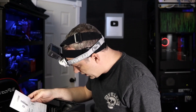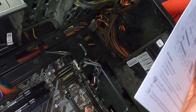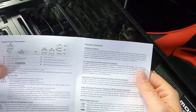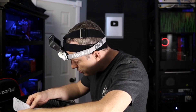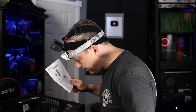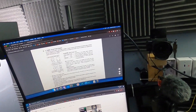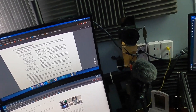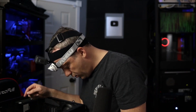This is a bit cruel and unusual. The F-panel — the front panel with power and reset — usually has a diagram in the manual, but this Gigabyte manual is pretty terrible because it doesn't even have one. You have to go to a computer, look up the model number, and download the full manual to see how to hook up the front panel. Bad job, Gigabyte. I pulled up the diagram: power LED is on pins two and four, two being positive. Got the front panel hooked up and everything looks good.